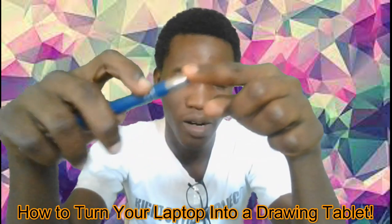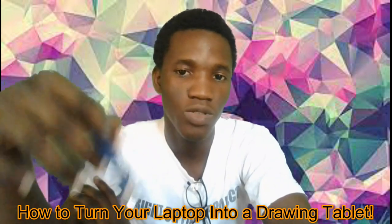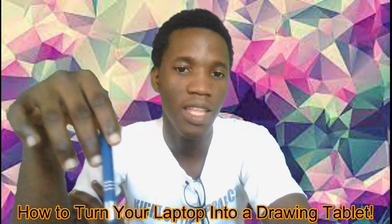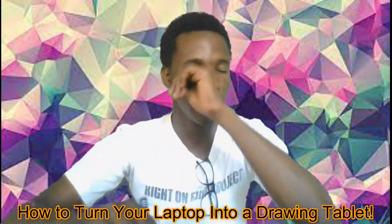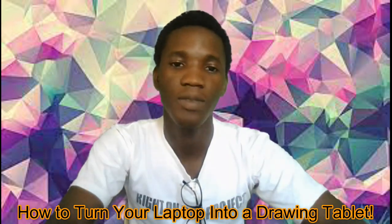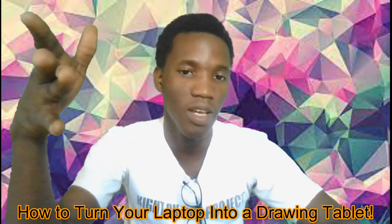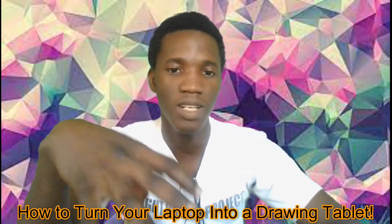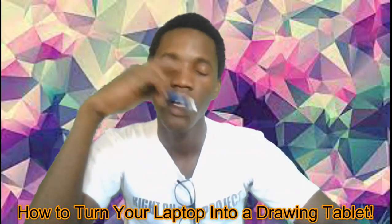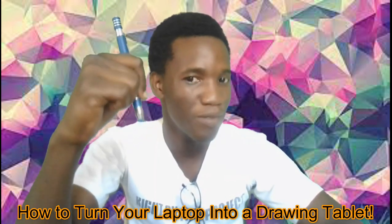That's what actually allows you to put your hand on the pen, and then the charges from your hand flow into the pen, and then you're able to put it on the touchpad and it works just as if you're putting your finger. When you put your finger on the touchpad, it's sensitive enough to detect that there's a finger or a hand — something that charges are flowing through. So let the mouse move according to how the finger moves it.